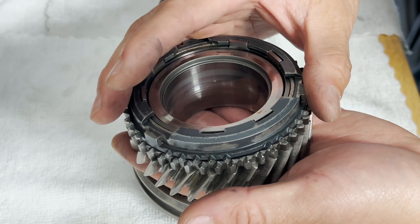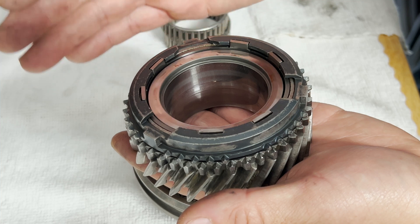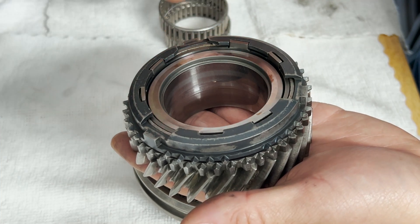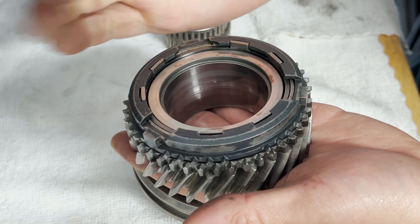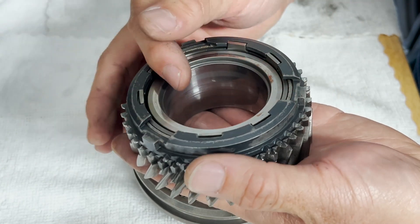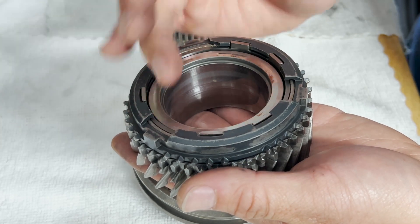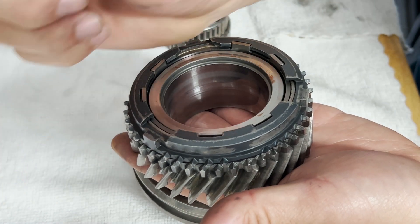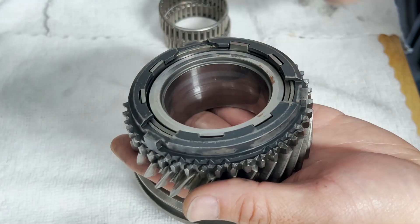The shifting feel reflects this difference — there's a lot more resistance when shifting into first, second, and third gear. From third gear to fourth there is a slight difference in shifting feel because you're transitioning from a triple-cone gear to a double-cone gear. If you ever drive a gated manual Lamborghini or R8, that difference in feel from third to fourth is actually by design. It's really interesting.